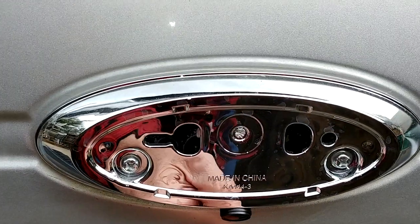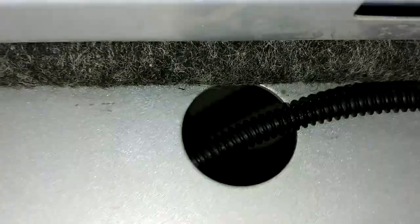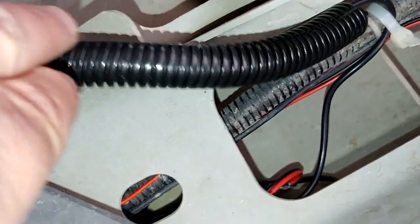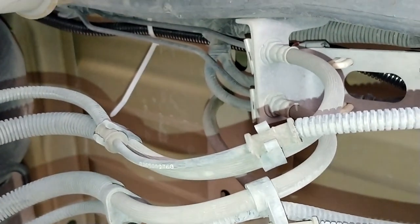Here's the rear backup camera. The camera is right here — I haven't put the emblem on yet to make sure it's working. You can see where the cable comes out and runs into the back of the truck. Going underneath the truck, you can see the cable runs across — here's where the switch is, positioned up to protect it. The power cables run up into the driver's side rear taillight. The video cable connects out of the switch, and I purchased plastic split tube to put the wire in for protection. The power harness runs all the way up front, around the gas tank, up towards the front of the truck.